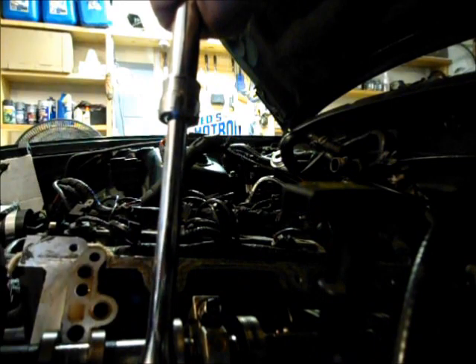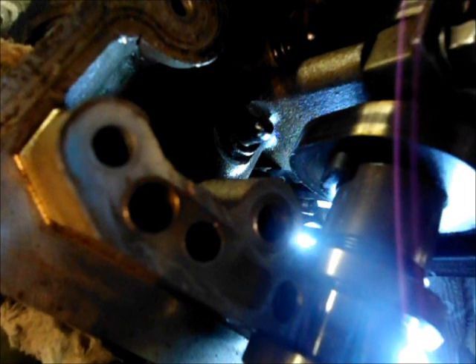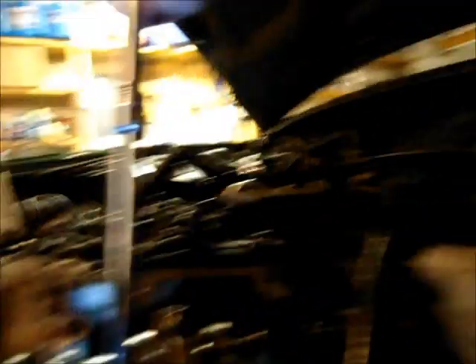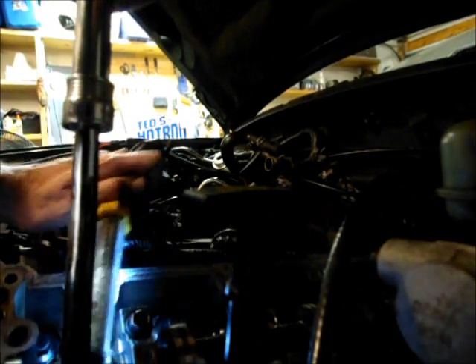The tool is working great. The problem I'm running into here is the spring is compressed and ready for me to put the keepers in there, but I can't get my hands in there at any angle. So I'm going to have to find a helper to hold this ratchet while I meticulously put those keepers back down in that spot. I just wanted to show you guys — if you decide to try and do this, this is what you're in for. And if you take the heads off, that would be easier.